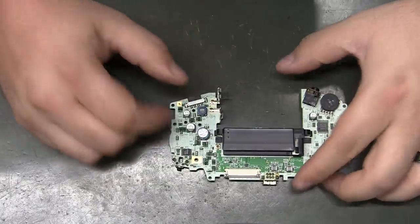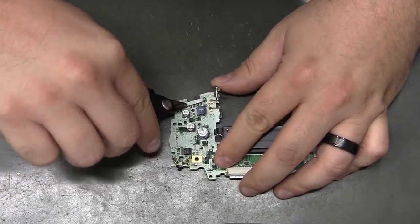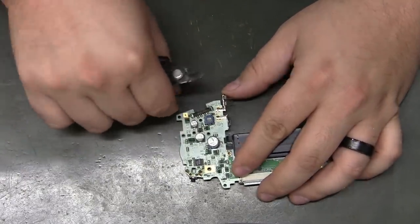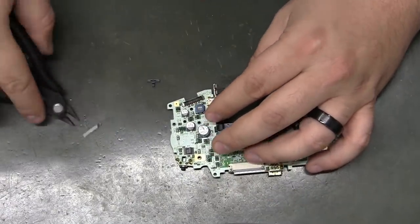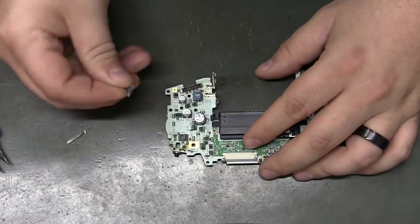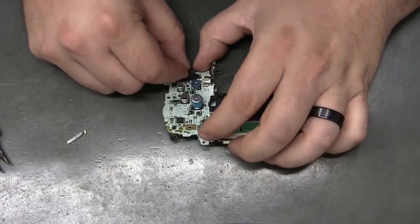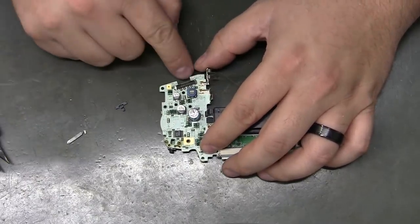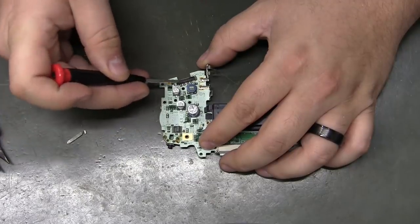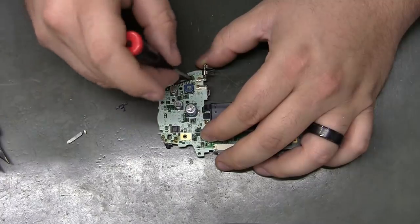So, on the power switch, this way is on. One thing I was doing was clipping the casing on it and taking the actuator completely out of it. I'll get a close-up shot, but you can tell, maybe even from there, that the inside of this is disgusting. The actuator is nothing more than a couple of contacts that slide from this side to that side. When it's all the way over in the on position, you're basically shorting the very left pin to one of the two middle pins, which are actually one big contact in the middle. Even just running my screwdriver over that shined it up quite a bit.